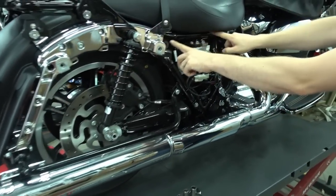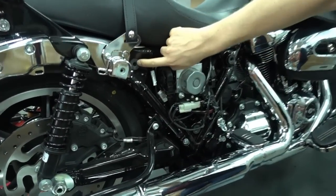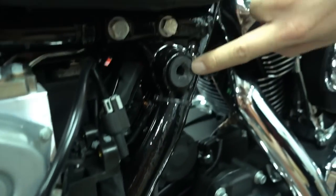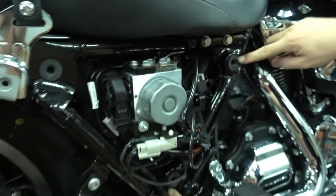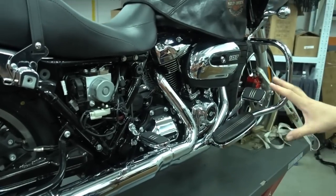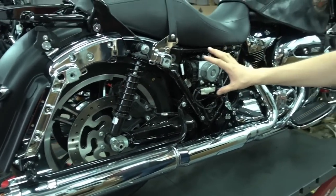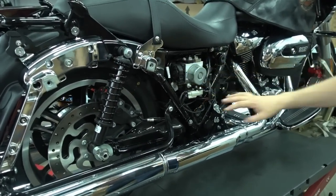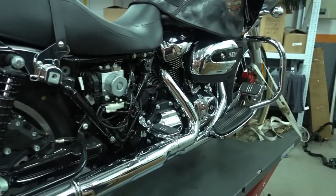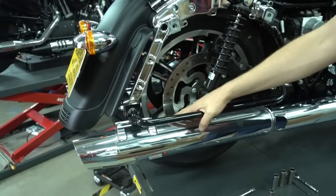And then you have to remove the side panels. They're only held with 3 pins on here, here, and here. There's no screw or bolt or anything, you basically just pull them off. And then you're exactly at this state where we are right now. These 2 steps have been done a few days ago when you took off the parts for the paint shop. So what we do now is we start removing the mufflers first, the original mufflers.